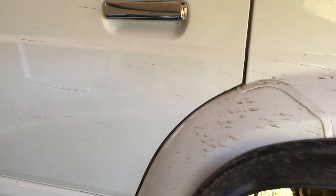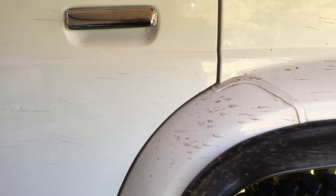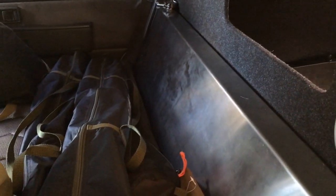In the middle of the car, behind the middle row seats in front of the drawers, we've got the built-in water tank. Up on top there's a fill point, and there's also a point a bit lower down where you can just click in a hose to the mains and let it run until it's full. Over this side we've got a breather. Down the bottom of the tank is the ball valve, which controls the flow to everything, so we can just shut that off if there's any leaks throughout the system.